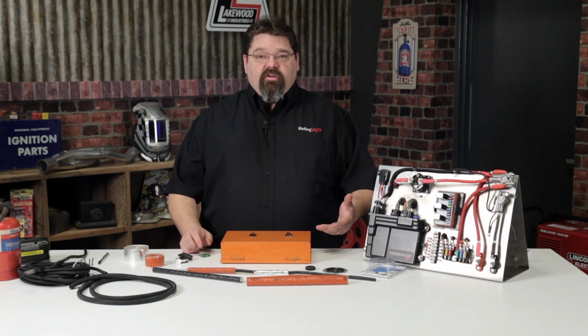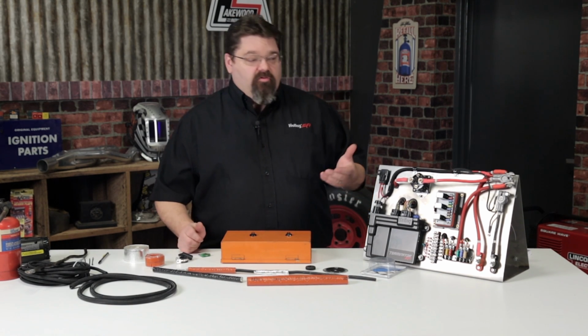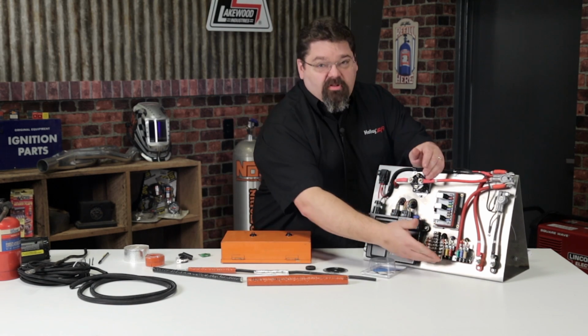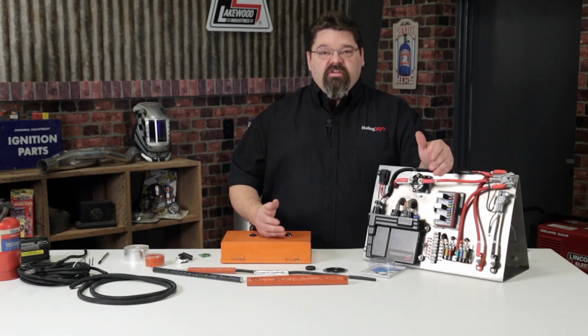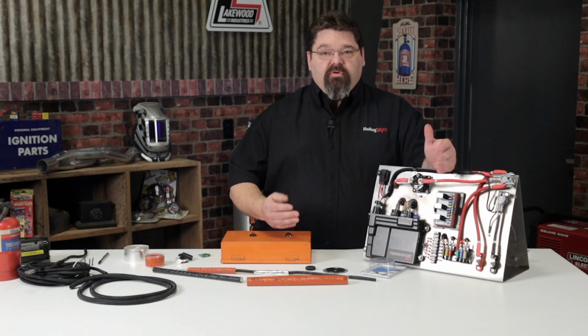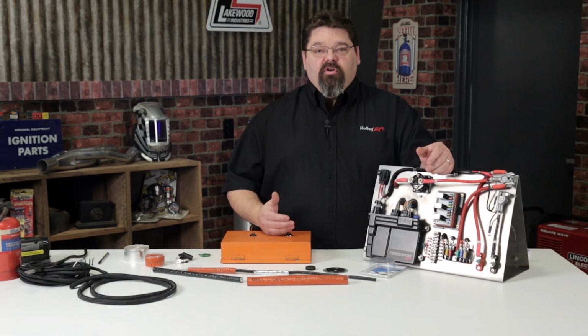Individual circuits that are in the wiring should also be protected with the correct size wire as well as the properly sized fuse. Things such as transmission fans and trans brakes should definitely be protected with a fuse to protect these circuits if a problem occurred.